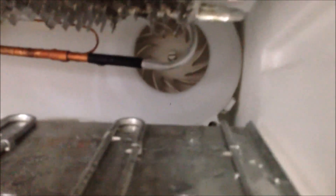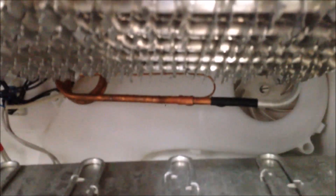You're going to have the fans over there — that corner is the fan. If there's too much ice around the fan, the fan will be blocked. So we're going to leave this open and wait for all the ice to melt. Here are the wires — I think these are the electric wires connected to the heater for defrosting, and the upper one is the evaporator for cooling. You can see the fan here; if you rotate it, it should be free when there's no ice.